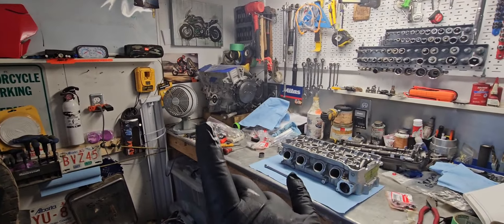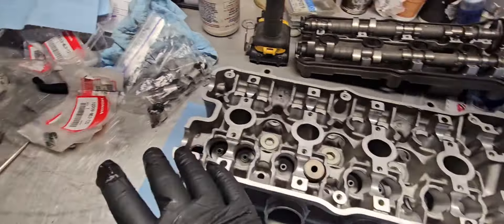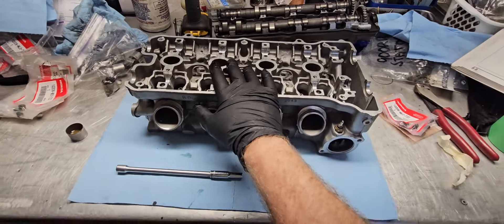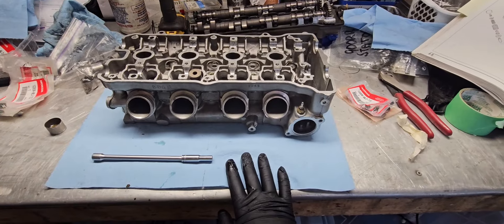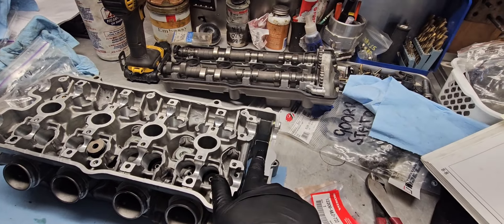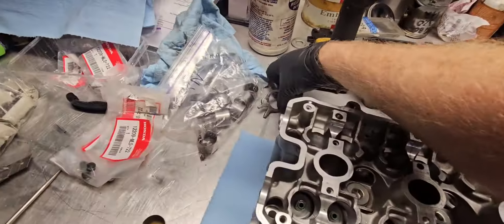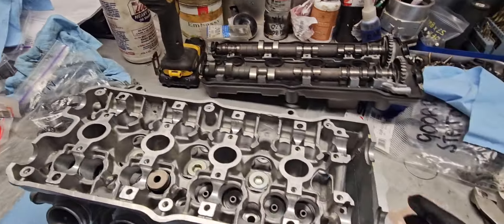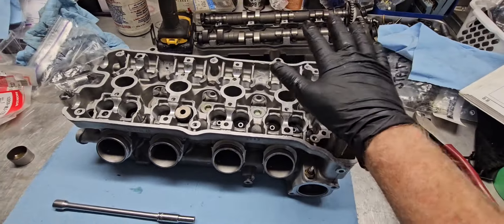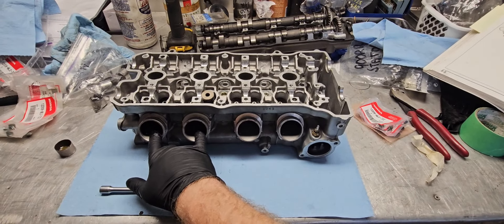I've been putting off redoing the valve seals and rebuilding this head — basically putting all the valves back in with brand new seals. There were thoughts of adapting this 900 RR carburation to fuel injection, but I would have had to get the exhaust cam shaved down quite a ways to have a pickup ring for the camshaft sensor, and then position the sensor at an angle to catch that. Also, the 929 throttle bodies don't line up with the 900 head.